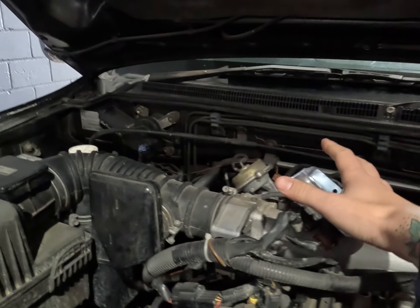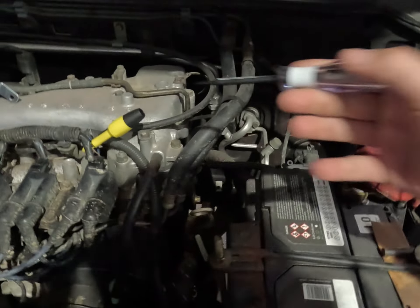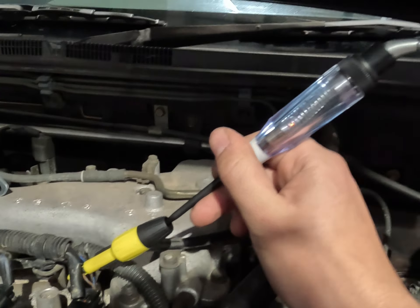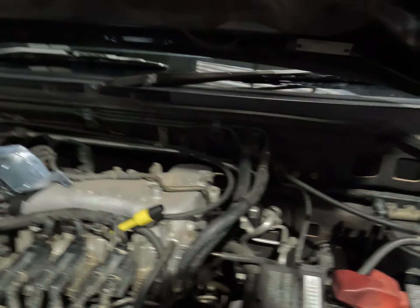Follow-up on our Pajero — we've got our new ignition module. The old one is still in there because we've got to wiggle it out, but as you can see, with the test light hooked up to battery positive, this is our control wire — that ground wire from the module — and we do have good control now. The ignition module is fixed. For anyone's interest, AFI parts is actually a genuine Mitsubishi part — this AFI module comes in a genuine Mitsubishi box stamped with all the Mitsubishi logos. The car is all fixed, running good, cleared the codes and good to go.